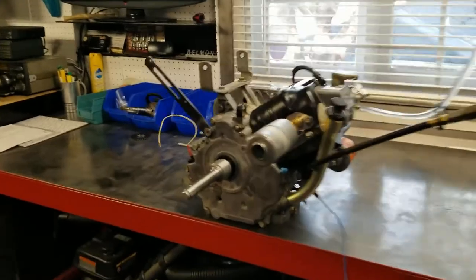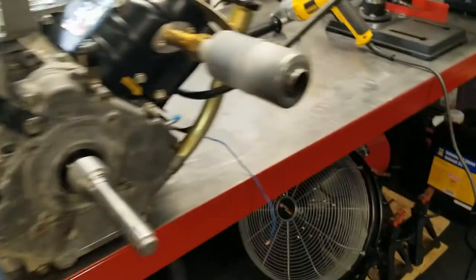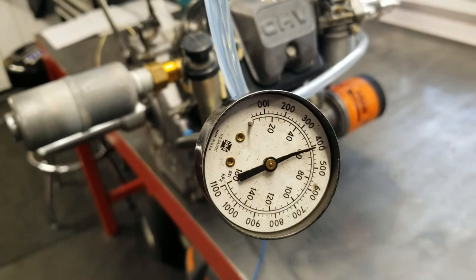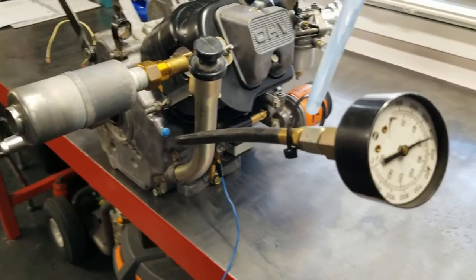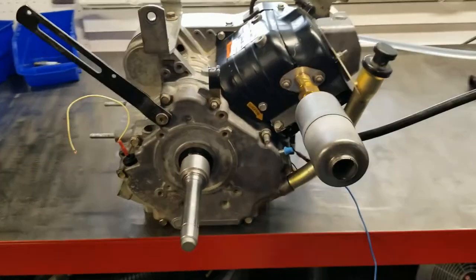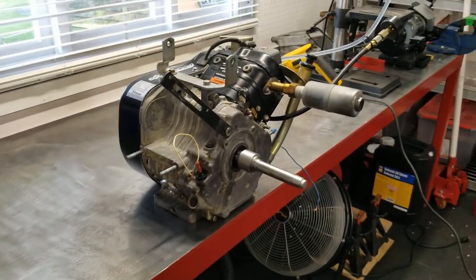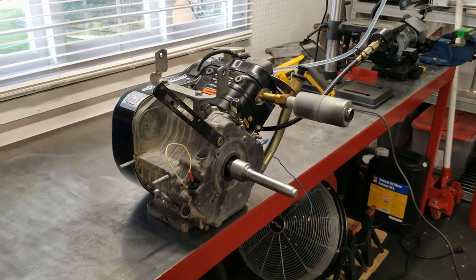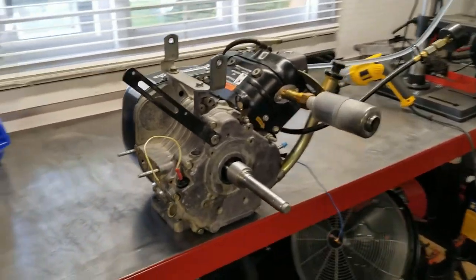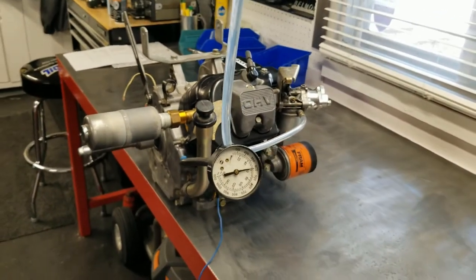I've got this running — it's a little iffy, just moving the shim off the bench as it's dancing around — but you'll see our oil pressure is right up around 60 PSI. As I said, that'll tame down to about 40 when this thing warms up. There really is no reason to shim that oil pressure spring; it's totally unnecessary. The bypass is there for a reason, the check ball isn't against the seat for a reason — it's there to prime the oil pump. Thanks for watching.